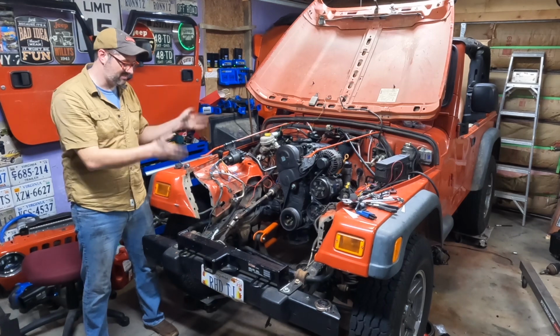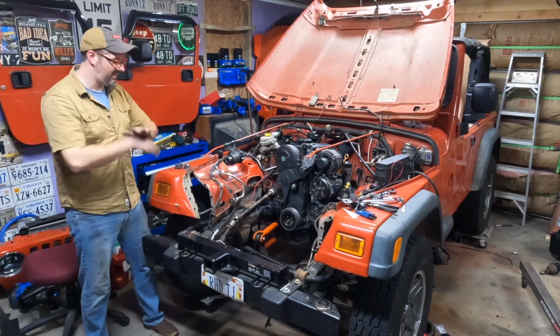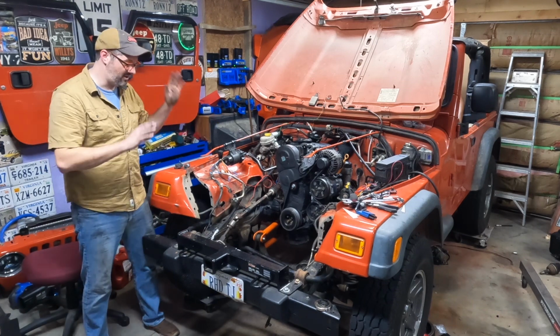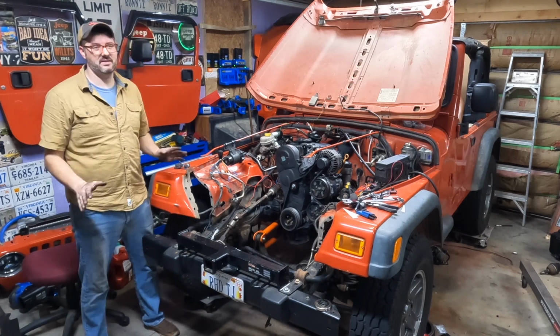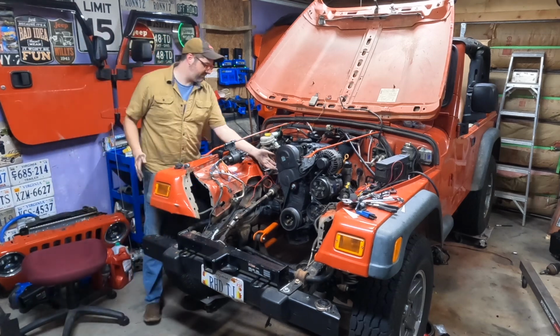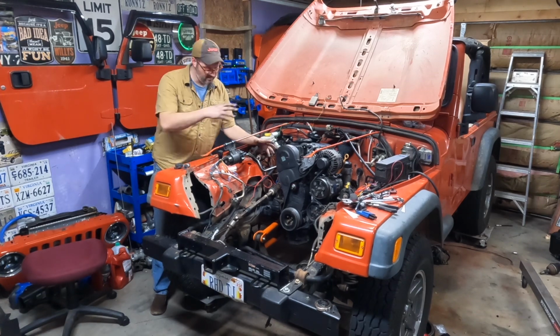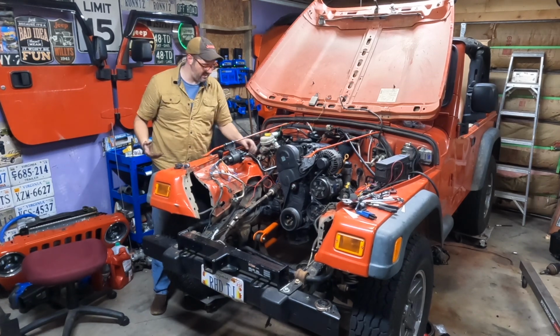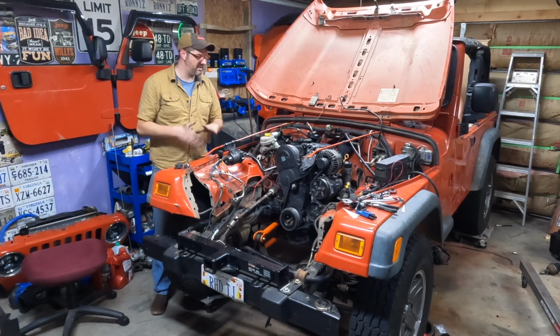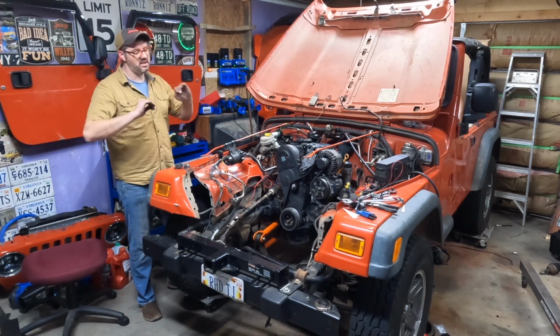It's in. It's mounted. The drive line is being supported by its own bracketry. I have no jacks underneath of it, no nothing. And all of my clearances look fantastic. I did just briefly try putting on the turbo because that was my biggest concern, was that once everything was under its own weight, it wouldn't clear my steering shaft. It clears wonderfully. So I am thrilled.